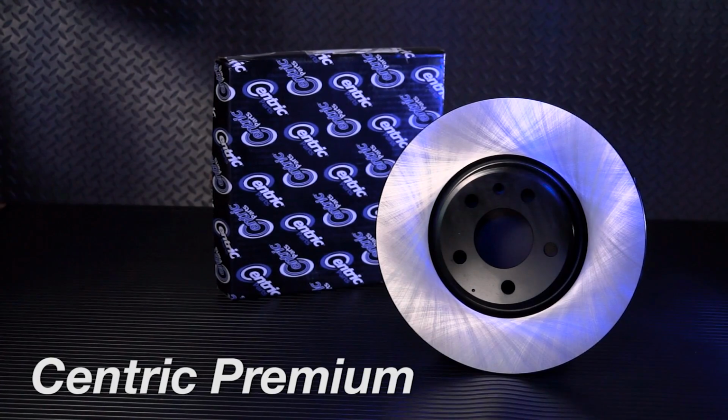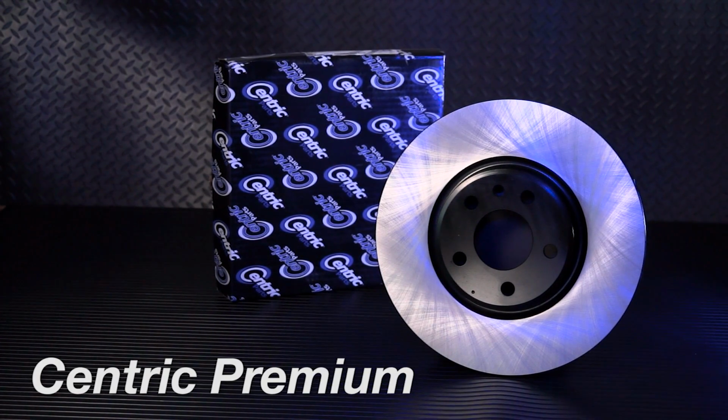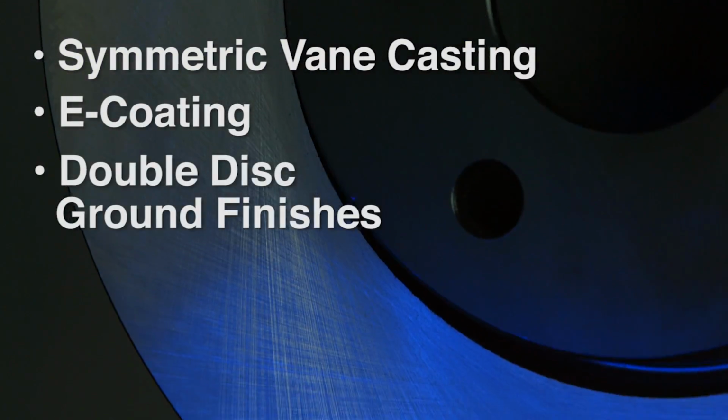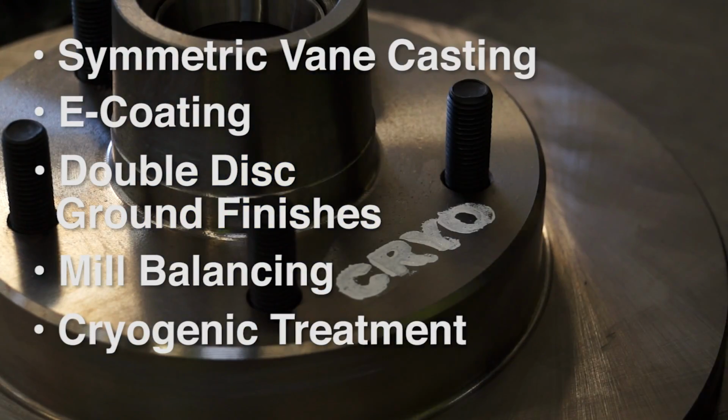Take a close look and you will see the features that set Centric premium rotors apart from the competition, including symmetric vane casting, e-coating, double disc ground finishes, mill balancing, and cryogenic treatment options.